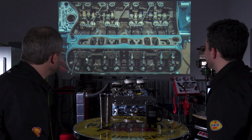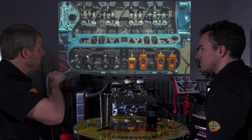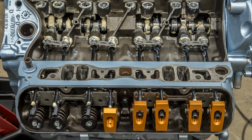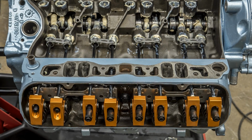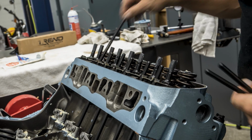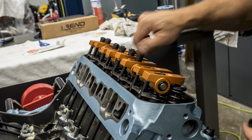And the reason for roller camshafts is you can get a more aggressive cam profile, and of course less friction with a bearing. Likewise with our Howard's rocker arms, they have a roller fulcrum. You get a better view of the roller rockers here. In goes all the push rods. And those trend push rods are nice. Get a better view here of the rockers.